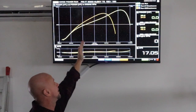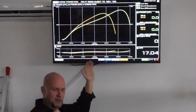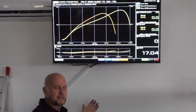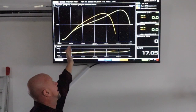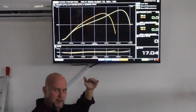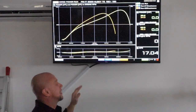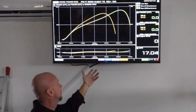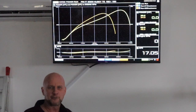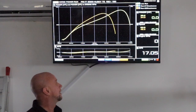The different shapes are because of the rate the power valve opens. When you're wide open, it blows through the RPMs faster in fourth gear than in fifth, and the power valve is an RPM-based mechanical opening device on these bikes. So you see a different shape, and that's why you see the dip in the fifth gear run — the power valve holds on, then finally springs to life. Maybe with a different spring or adjustment we could change that. The air/fuel ratio is really nice at 13:1 all the way through at wide open throttle. On the bottom they are blubbering and crappy — these bikes are underpowered there — but there's huge potential, and that's what we're going to unlock next. We've got our baseline, so let's get to work.